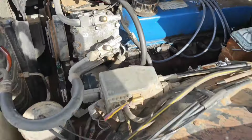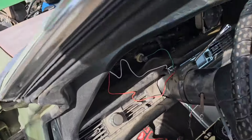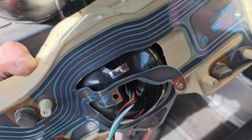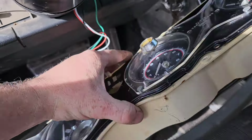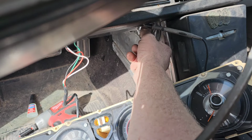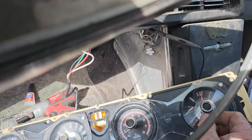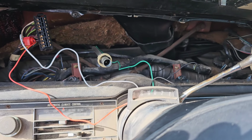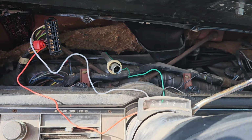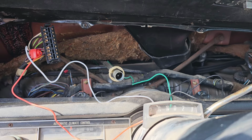Okay, now then before you want to fire it up, I already touched on it on another video. Can't tell you enough. On the back of here, make sure you slide that selector switch to how many cylinders your engine is, or it's not going to read properly. Let's fire this baby up. There you go. Now all I got to do is slide the speedometer cable back in, hook that plug into the back of my dash. Then we'll get the bezel put in and all that stuff, and we'll try her out.